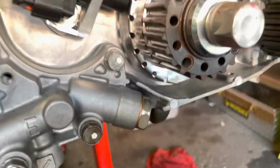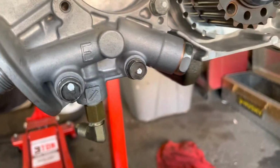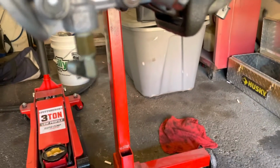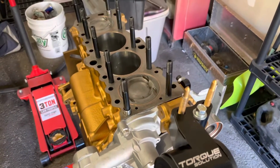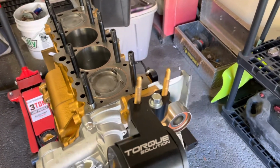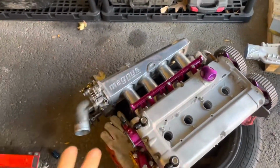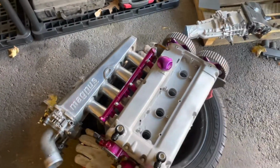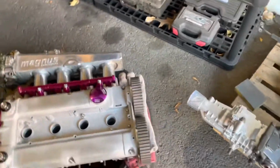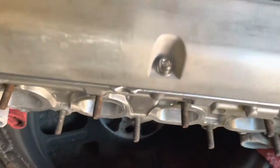I had the pistons polymer coated. It's like a newer thing, but supposedly you have a little tighter clearances with the polymer coatings on them. So we'll see how that works out. And then I'll post a couple pictures. The valves on here are beautiful, but I'm not really gonna hold it to a point where you see them. But other than that, the head was fully built also.